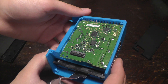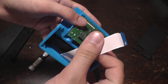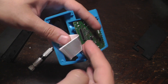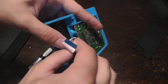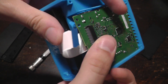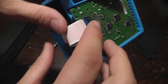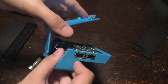Once you've gotten in all four screws — I've only put in two — you can connect this ribbon cable back up with the main board. What you want to do is pull it out this way, then make a little crease right here, and push it in under the board just like that. Now make sure to lift this part of the ribbon cable connector, then slide in the blue part of the ribbon cable and push it back down. Now that that's in, we can put the back cover on.